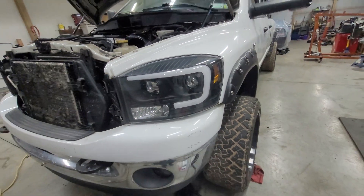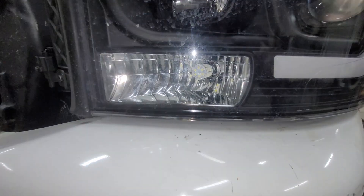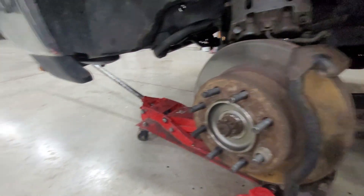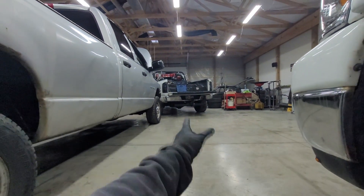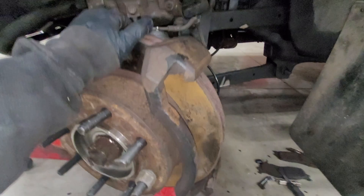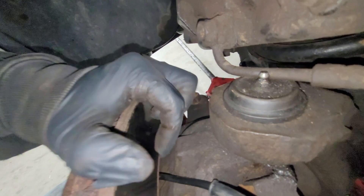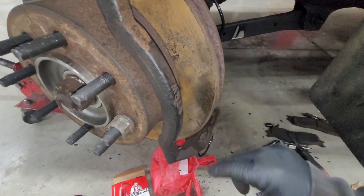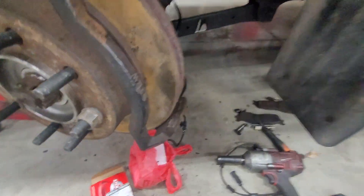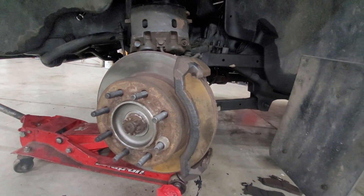Go check out Part Sam — those bulbs are pretty freaking cool. Alright, so this is the next day. We got mine in here for the mobile stuff, and we got this one in here. Finish up that electrical stuff. Unfortunately on this one you've got to bend this bracket a little bit — it was hitting on that guy there and it'll short it right to ground. We're going to get these cleaned up a little bit better, then get the stuff back on, grease everything up, and slap it all together and hope that the ABS light is off.